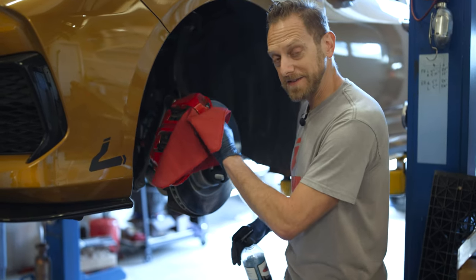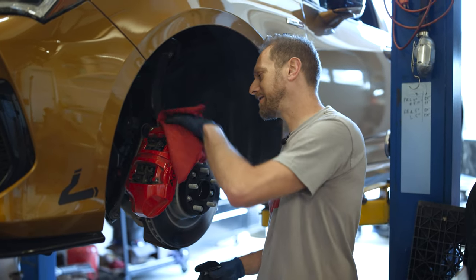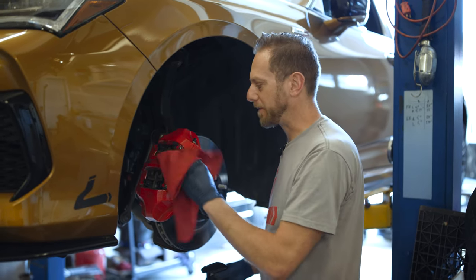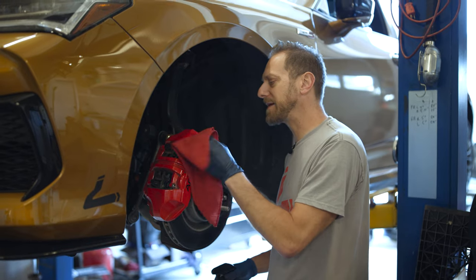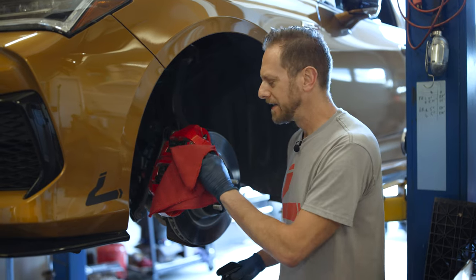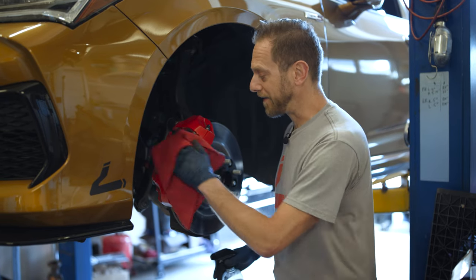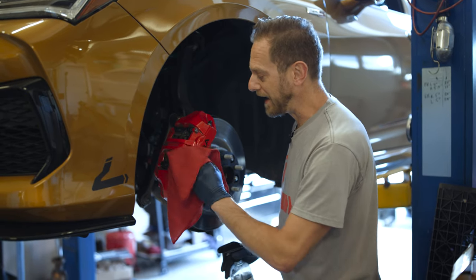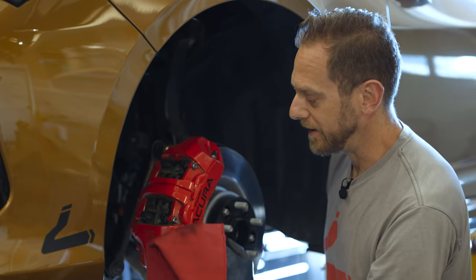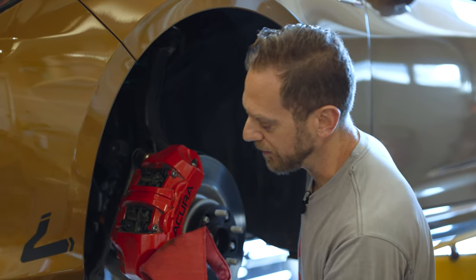As I wipe this thing down, a couple of comments to address questions you probably have. Number one: I didn't put any brake lube on the backing plates of the pads. Most of the time it'll tell you to do that. I looked up the service manual and it mentioned lubricant but honestly there wasn't any on the factory pads when I pulled them off. I don't usually go for that lube anyway — feel free to go without it. I don't think you must have a lubricant there unless you're having a particular noise you're trying to get rid of.